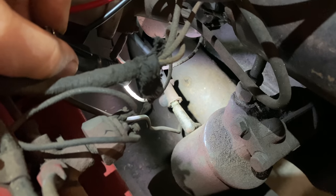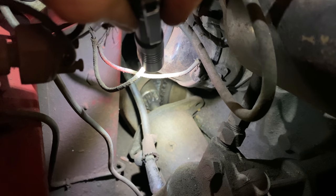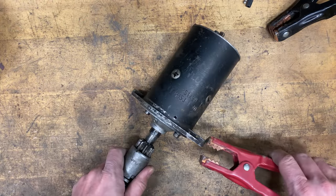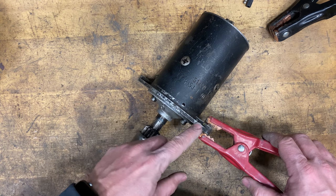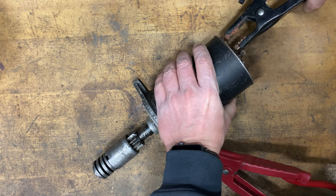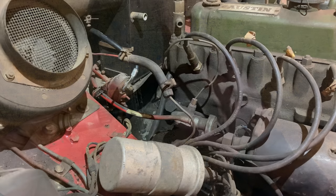That cable right there goes to the starter and it's actually disconnected from the back of the starter. In fact, it looks like the starter is not bolted up to the engine either, so I'm just going to pull it out so I can bench test it before I bolt it in. I don't want to bolt it in if it's not a good starter. I have the starter out of the car now. Let's connect the battery up to it and see if it runs. I don't need to worry about whether I'm using a positive ground or negative ground - the starter will spin the same either way. I'll touch my other clamp to the post and we'll see if it runs. It seems to run pretty good - I'll take this back over to the car and get it mounted.